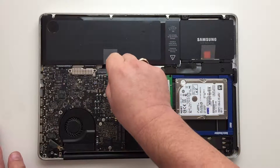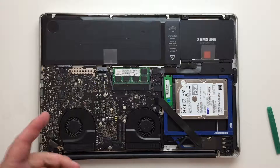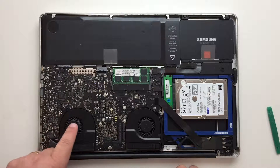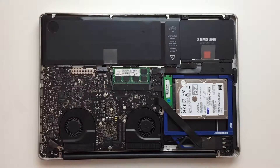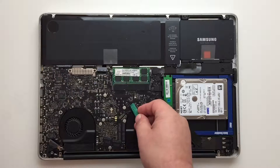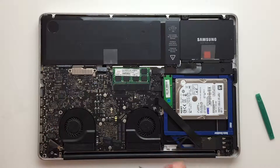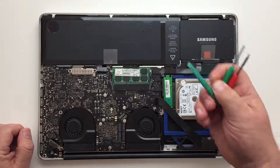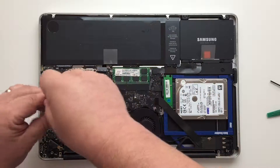The next step is going to be to unplug the battery. With the fans, you'll notice they're slightly different in the layout of their screws, and that's important when you go to order a replacement. If only the left fan is making noise, make sure you order the left; if only the right, then just get the right. I think it's just the left on mine, but just to be safe I'm replacing both. Now that we've got our power disconnected, there are these little power cables for the fans — I'm just going to gently use the spudger on those. To actually remove the fans, there's one other tool you're going to need that I didn't mention: a Torx screwdriver, also available from MacSales.com. In fact, all of these came together in the kit I got when I bought the data doubler. I don't remember the size, but I'll put that in the description.